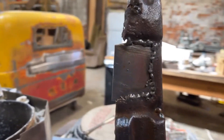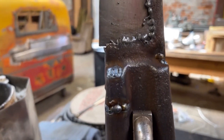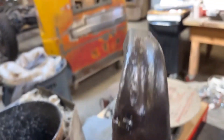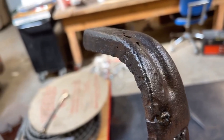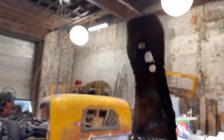We've got some progress going. Basically, patching that in, getting welded in on the front, going to weld it on the back. I've also found a bunch of pinholes that I've just filled with weld. This thing has a bunch of rot, and instead of just replacing it or fabricating a new one — which I don't really have the skill set for — I'm just going to fill it in and patch a couple spots to make it strong again.